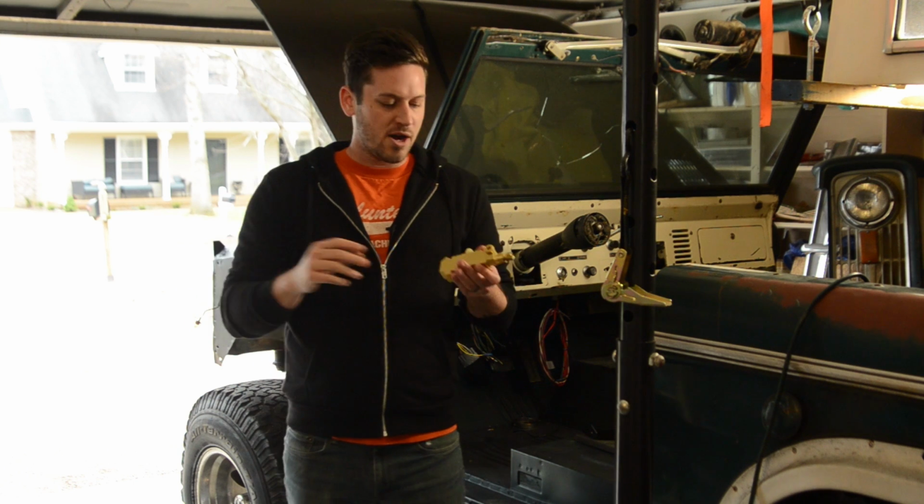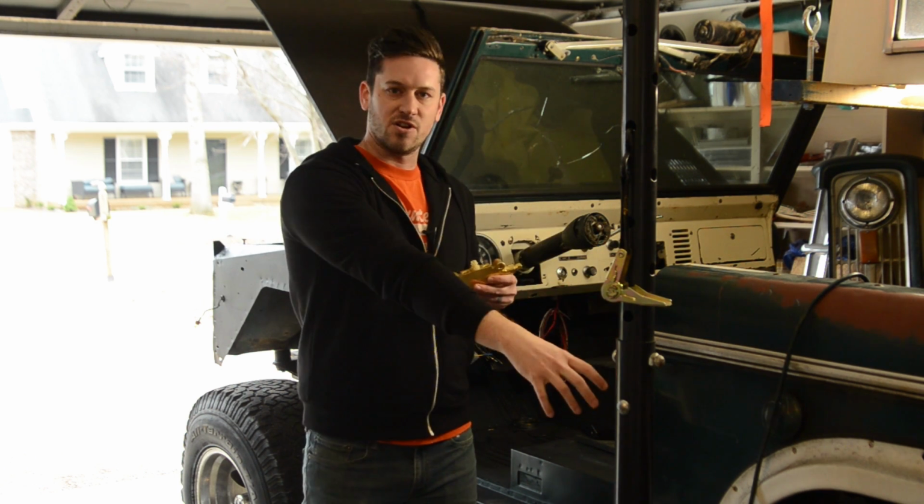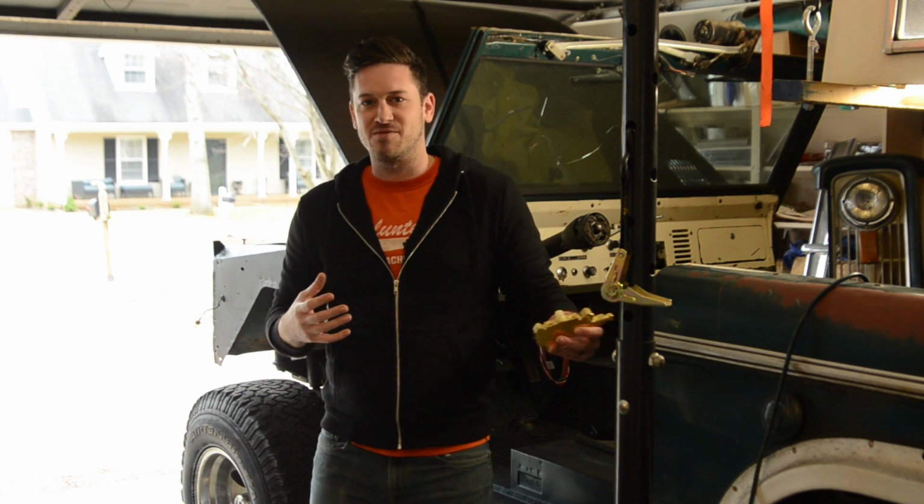And so what you want, and what this tries to do, is to get all of that working in harmony, to get your front disc brakes braking a little bit after your drum brakes begin to brake, but keeping the drum brakes from locking up. So it tries to get it all to work together.